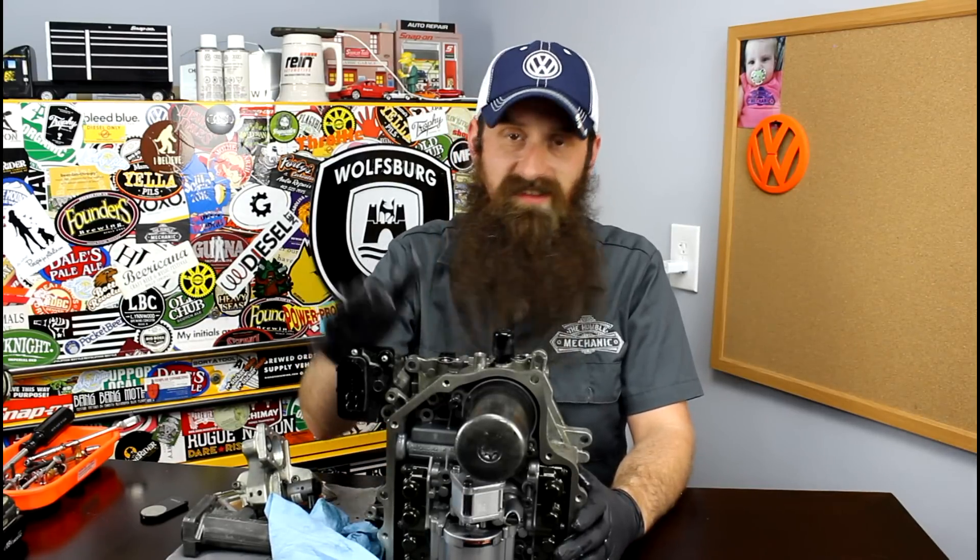So how does a Mechatronic unit fail? Well, odds are you're going to get a check engine light, an EPC light, or some kind of drivability or shifting concern. The hybrids are so few and far between that we really don't see a ton of them — this is, I think, the second one I've replaced. And each time they've been associated with a fault. This one had a stuck in sixth gear fault. Even though every time I drove it the shifting was fine, the fault would clear, but as soon as you drove it three or four times the fault for stuck in sixth gear would come back.